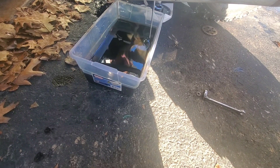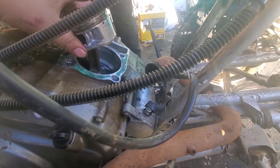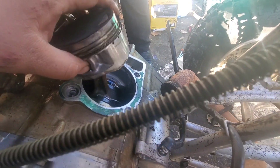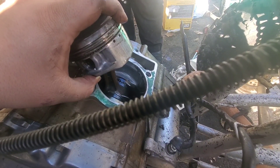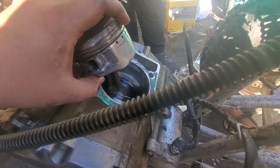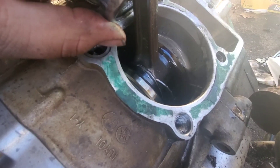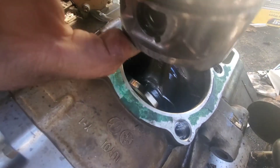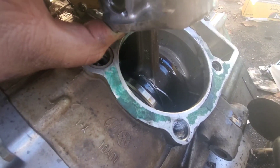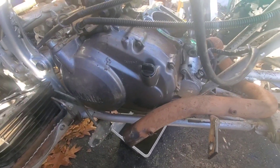There's a gear — that's the starter gear. It's not in the oil. Oh — it's done, Junior. It's gonna need the bottom end pulled apart. I can see pieces of the rod bearing sticking out. We barred it over and as you can see by the chunk of rod bearing sticking out, the previous owner ran this so low on oil that he locked the bottom end up. The rod is currently seized to the crankshaft.